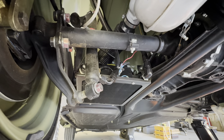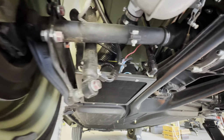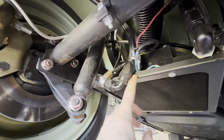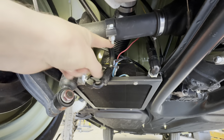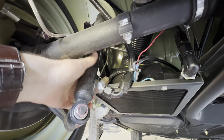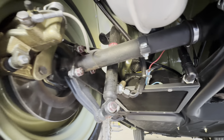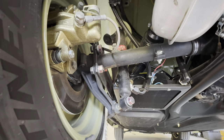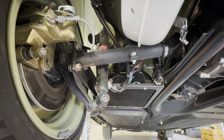I never had any clearance issues until now, because I haven't jacked my car up like this for a while. What happened was, once this axle came down far, it pushed on my AN fitting over here — because this hose was supposed to come straight across and then up. It's bent the nozzle down. I can feel a bit of oil on it, I think it might be leaking. It's twisted it down, which is not very good. I'm surprised it's not leaking more.